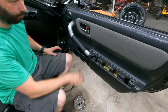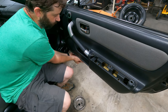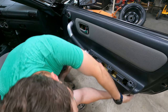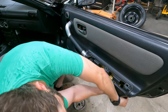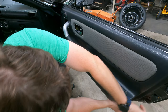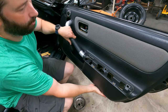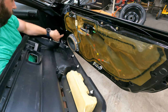So four screws, that cover, and this bezel piece are all removed. Now we can deal with the pop clips — you really just want to find a place you can get your fingers into and start pulling. You do want to be careful; this car is 17 years old so things are getting a little brittle. It's never been apart so it's kind of a tough one. You can see one pop right in there — very tight, apparently why it doesn't rattle. Once all the pop clips are loose, you just kind of pull up and lift off. I like to make sure all my clips are still in because sometimes they stay in the door.